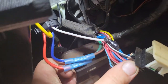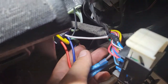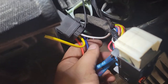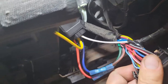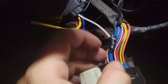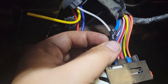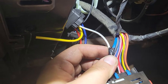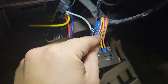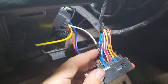To permanently fix this: clip those two wires, run them to the side, and splice them onto a relay. This is the normally closed position — we're not using the normally open. This is just a ten-dollar Amazon relay. For the trigger wire, I chose this big beefy blue wire. I cut the insulation, peeled it off, got to the bare copper, sent a pick in the middle to make a hole.